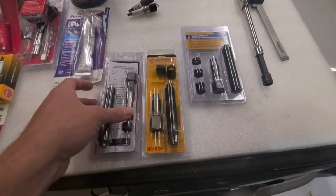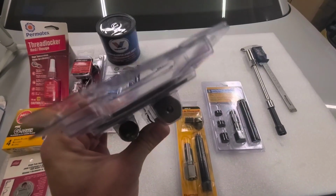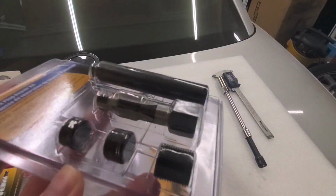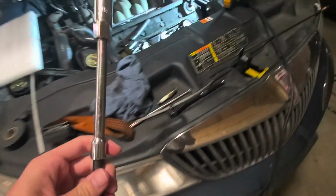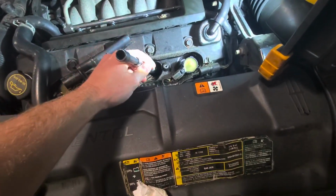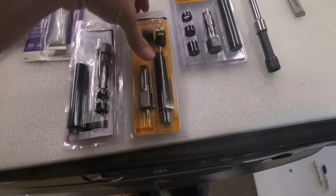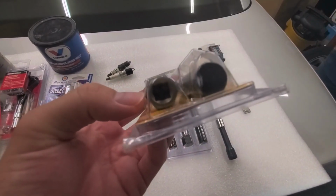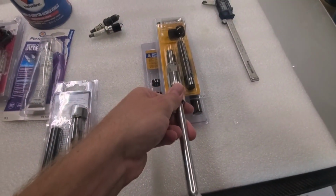One thing to keep in mind, and the issue we ran into, is some of these kits, as you can see there, do not have an option of inserting an extension. It's just strictly the 5/8 hex head, same as this kit here from Princess Auto. You can see there it is just strictly a hex head 5/8 socket. So the issue with that is if we take our socket and try to put that down the spark plug hole, it's not going to fit on the outside of the tool. So what you need, at least in our specific situation, is basically the exact same tool, but as you can see there, it has the hole in the top, so we can insert an extension, and that way everything will fit down inside. Because once we put that tool in there, it's not going to slide down inside.